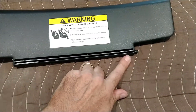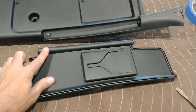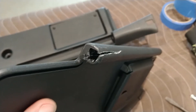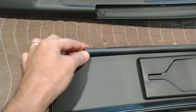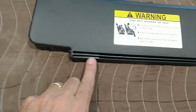What we're going to do is work right in here. This is the visor along with the part of the sub-assembly it came out of. The portion that fits in here is the issue — if you can take a look right there, there's a crack. That allows this to be a little bit larger than it should be. We're going to get this repaired by inserting a wire through it and tightening it up, and we'll end up hiding our wire in this channel area, which we're going to open up just a little bit more.